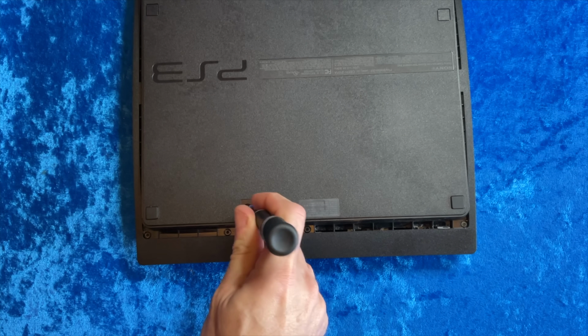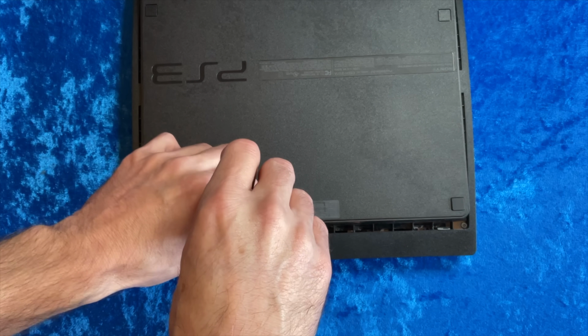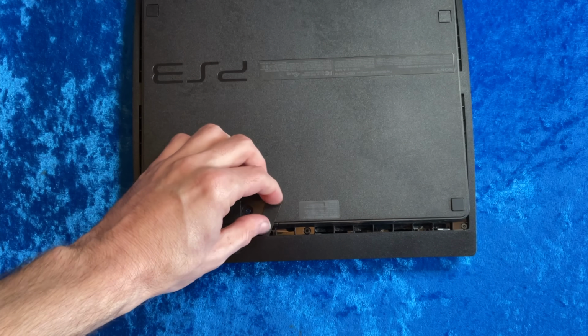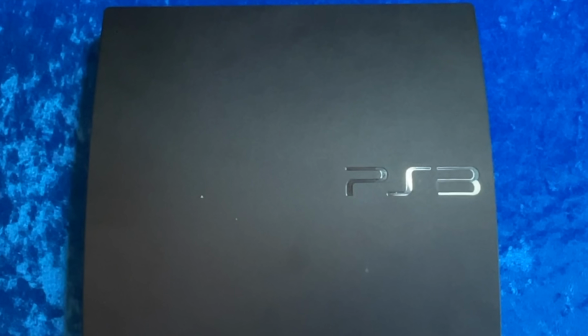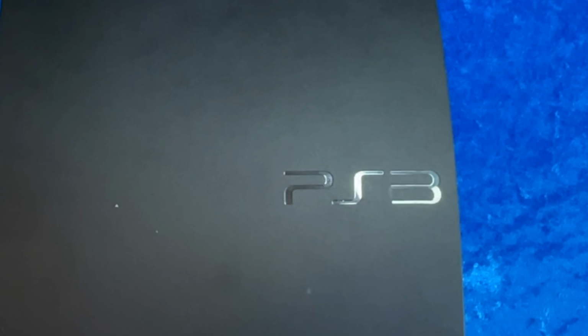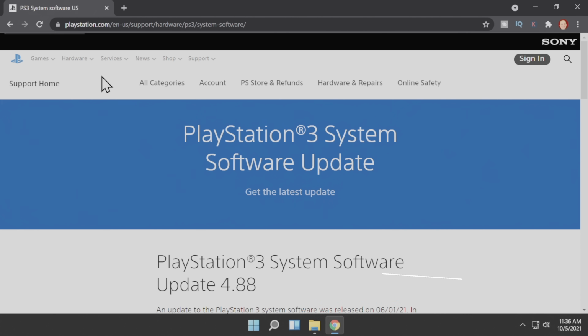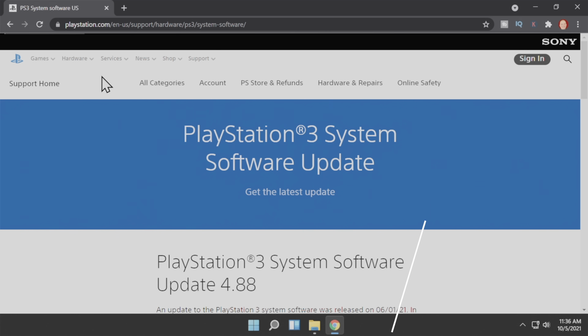Rotate the console face down and reinsert the hard drive mounting screw, the blue screw, back into place using the Torx bit. Rotate the screw cover plate and then press it straight down to lock it into place. The solid state drive's installed, but we still need to install the official firmware onto it for the PlayStation 3 to boot. Here's how that's done. You can download the official firmware for PlayStation 3 from the Sony PlayStation 3 website, linked in the description below.